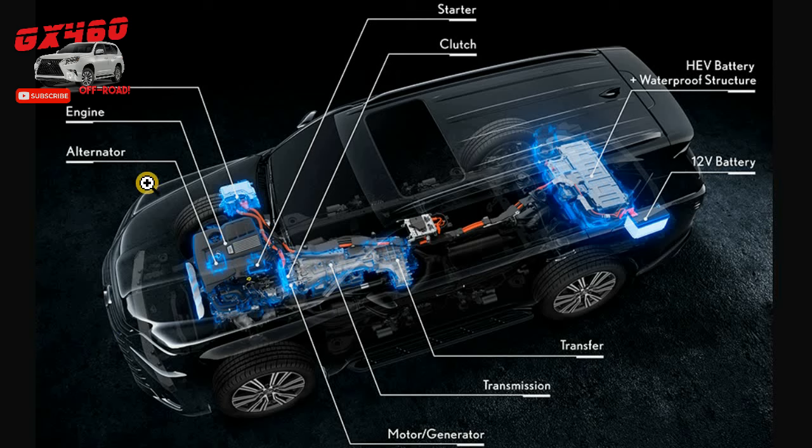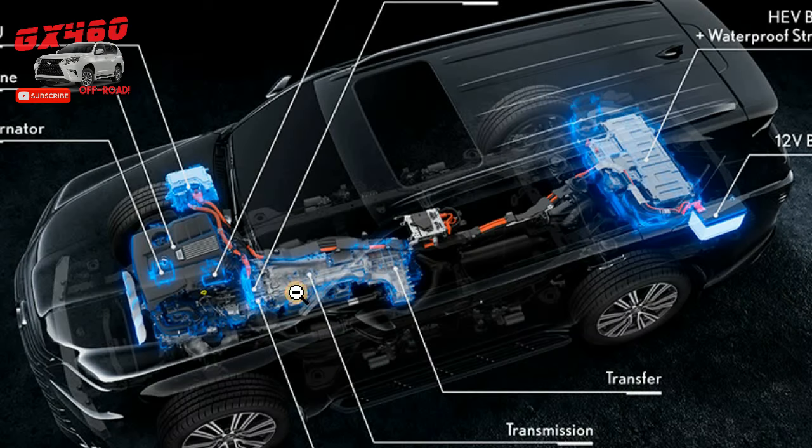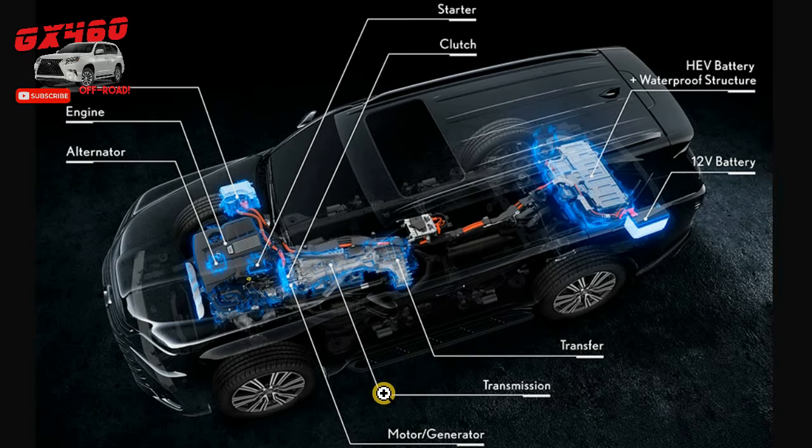Now, what about the rest of the LX700? What else is new? As mentioned, it's a hybrid. Now, this system is not new. This is what's known on Toyota vehicles on the TNGA platform, TNGF platform, as the Hybrid Max. All that means is down here, sandwiched in between the twin-turbo V6 and the 10-speed transmission, is essentially a motor assist, motor generator, and basically it gives you more torque. It's a torque boost, it's a power boost, and there's a battery pack back here.